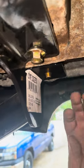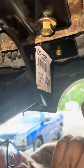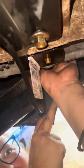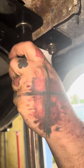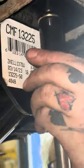We've got to make sure we don't push up on that bolt when we're threading the nut on. We gotta be careful not to press up into the bolt and just start our threads real gingerly, but I can actually get my fingers on this one. That way I can put pressure against it and make it easier for threading. All right, and there we go — our nut is now started. The hardware works as a stopper so we can put as much torque on it as we want. And that is installing hardware through a frame, guys — that's how you get your trailer hitches on.